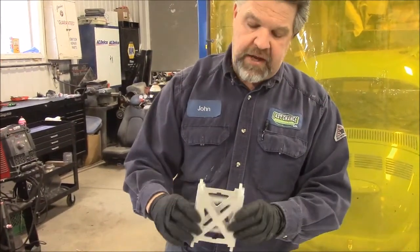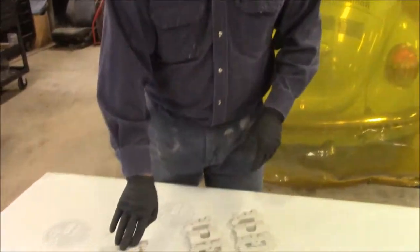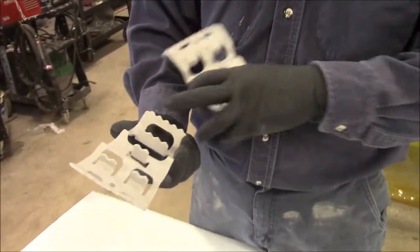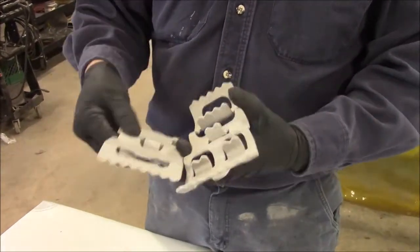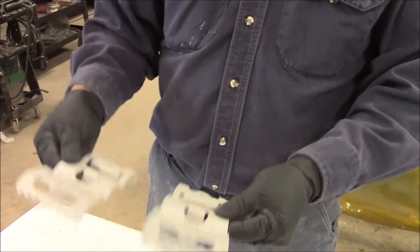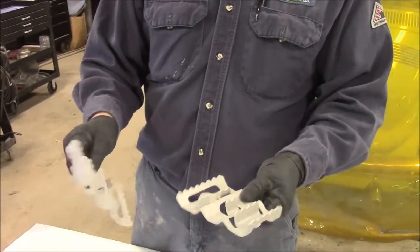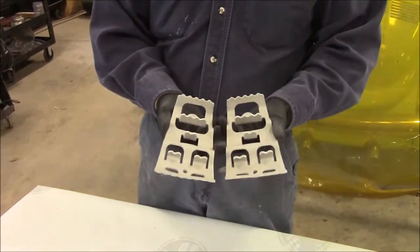The client is going to be putting the snowmobile together at their own shop. We have the steering items ready — they'll be gloss black as mentioned. We also have these aluminum pegs that were previously painted black but were chipped and in poor shape. We've media blasted them in our special cabinet with the correct grit, wiped them with a special solution, and they're ready for coating too.